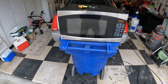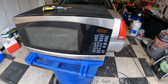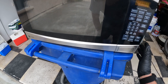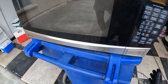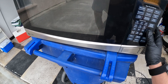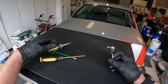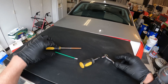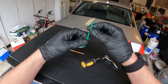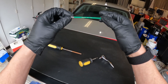What's going on everybody, Grim Repair here. Today we're working on a GE microwave that's not heating anything up and it makes a loud buzzing noise, louder than normal. I suspect it needs a magnetron and today I'm going to show you how to change it. Tools you're going to need are a couple of Phillips screwdrivers, a piece of metal or screwdriver, and some security Torx bits — on this microwave it happens to be a T20.